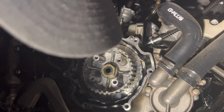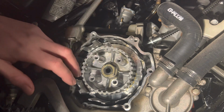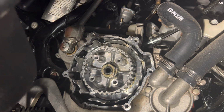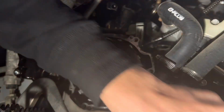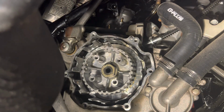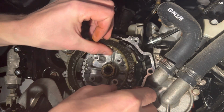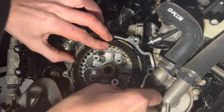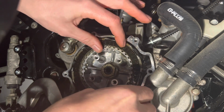And also, if you do have the tool to hold the inner clutch hub, be careful when you clamp it on that you don't overtighten it, because if you do, you take a risk of actually warping the inner clutch hub, and that's not good either. So just be patient, take your time, keep your fingers out of harm's way, use a rag to cover that thing, and make sure you have a good way to secure it without tearing your stuff up. Usually if you put the friction plates in the clutch pack back in, it'll add a little more resistance to help you break it loose, because that hub just wants to spin freely with nothing in there to give it any kind of resistance. So just be patient here, don't get your fingers caught in the clutch hub trying to rush to get it done. Take your time, be safe, don't do what I do.